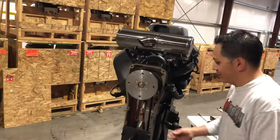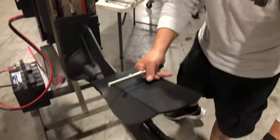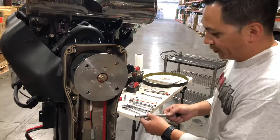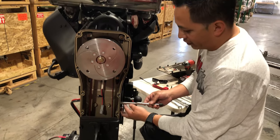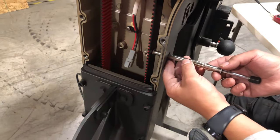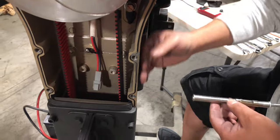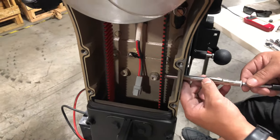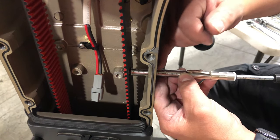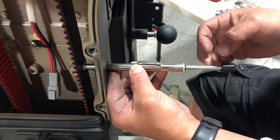So I tightened the belt a little bit — you start feeling the tensioning with the bolt going up. You want to spin it in the direction that the crankshaft is turned. We're going to put this into the side hole. This is important: you're going to use the outside wall of the belt housing as a reference. We touch the belt and use as a reference the first notch that is lining up with the outside wall.